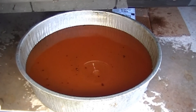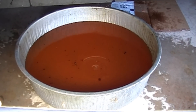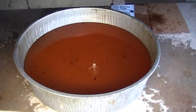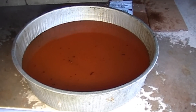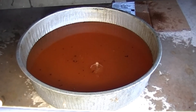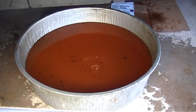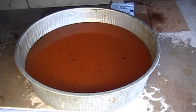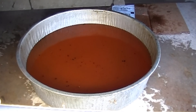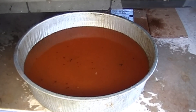The moral of this is: if you're using a pan to drain your coolant and you see oil, think about what you used it for last. If it was clean when you started and you see oil, then you can go ahead and have a panic attack — because that means you've got internal problems that will probably require the head to be pulled off, which is not going to be inexpensive. But anyway, looks like we're back on course. We'll continue to let this drip for about another 30 minutes.